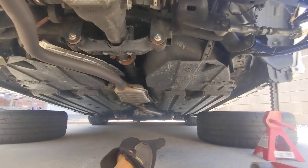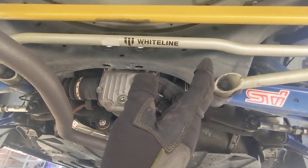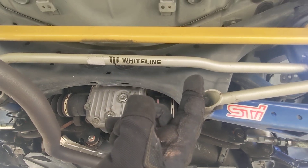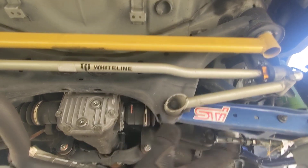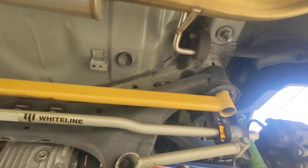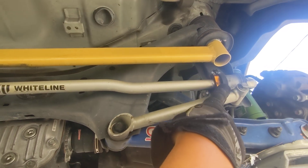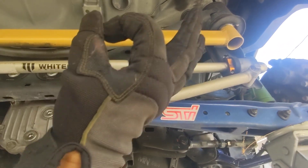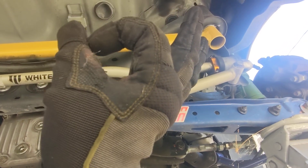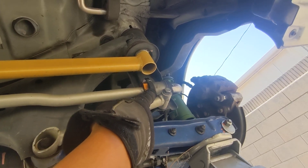You want to be able to balance the front and rear. I would recommend someone try the 20mm first — it's 100 bucks, so you're not really throwing away money and you can always sell it again, which is what I did until I got the 22mm because I wanted the rear end a little bit stiffer. Also, when you upgrade the diameter of your sway bar, you need to upgrade the sway bar bushings themselves, because the hole for a 16mm won't fit a 20mm or 22mm — sway bar bushings need to be upgraded as well.